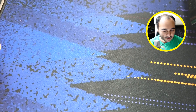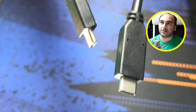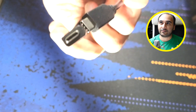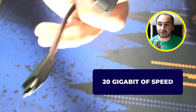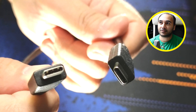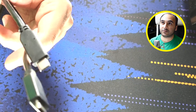Now I want to show you another cable — this one is very small and short. When I plug it in I'm able to test it, and this cable can get at least 20 gigabits of USB. I think I've tested it with Thunderbolt too but I'm not 100% sure. This cable also has all the pins filled out. It says USB 3.1 on the cable and can carry 20 gigabits of speed, which is fantastic.